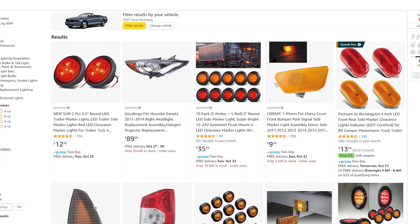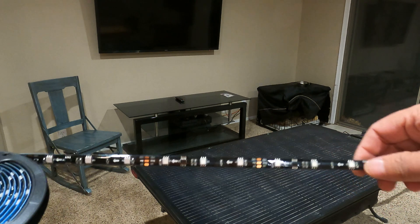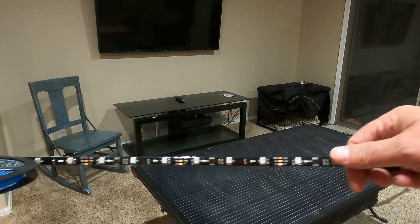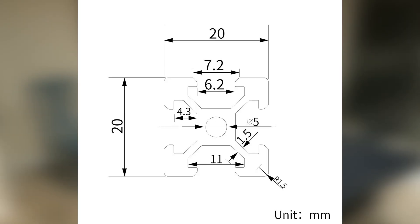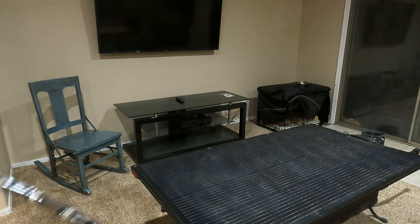My idea at first was just to add the normal Department of Transportation orange lights to the side, but then I got thinking — the better option would be to add some strip lights. These are what they call individually addressable LED lights. They can do cool running effects where the light goes up and down. Luckily they're 10 millimeters and the slot inside the 2020 aluminum rails happens to be 11 millimeters, so they just slide perfectly inside. I'm going to slide a strip in each side.